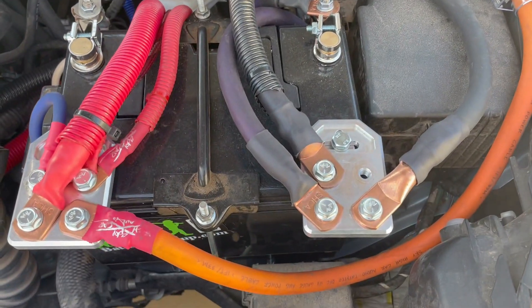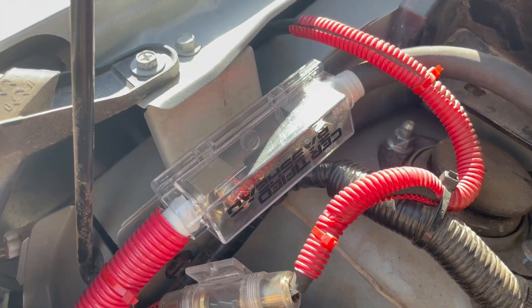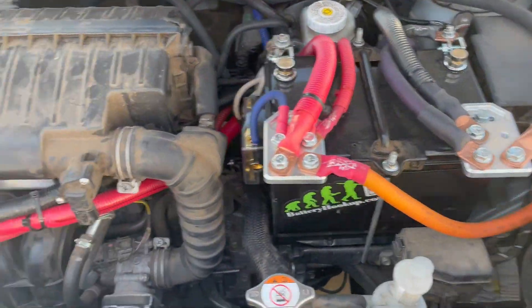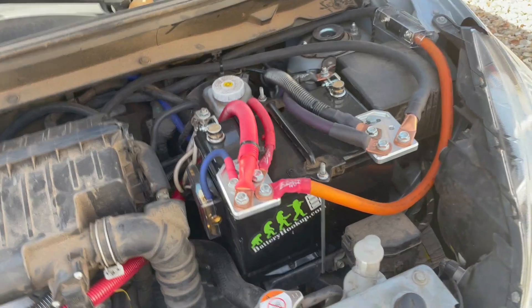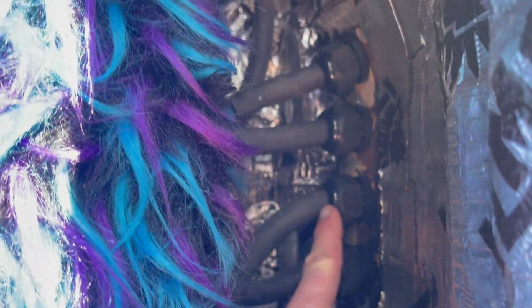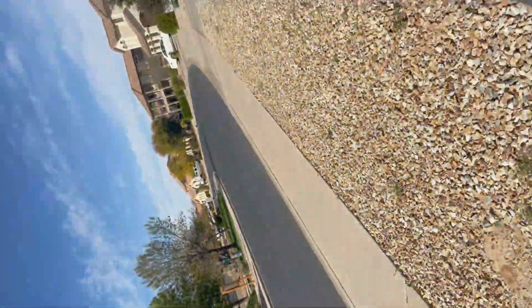Then we're going to be doing a big three. You can see we got a bunch of grounds, a bunch of powers, fused power runs running to the back. The big three improves your ability for the battery to take power from the alternator and then send it back to the frame to complete the circuit. Finally we are running all those runs underneath the car through to the back and into the trunk. We've got these big firewall grommets with all our power runs — two grounds and two powers — going to our lithium bank that is under this platform. There will be another video about the building of that.